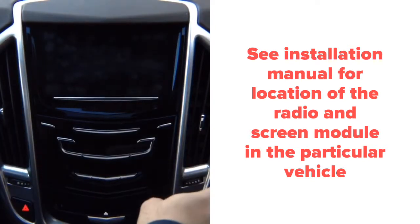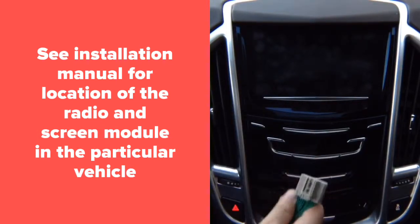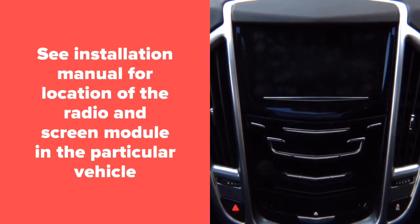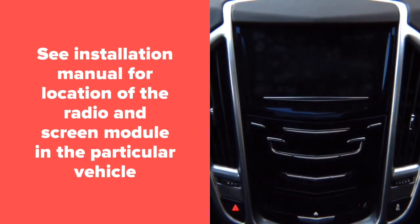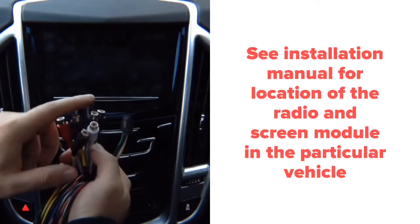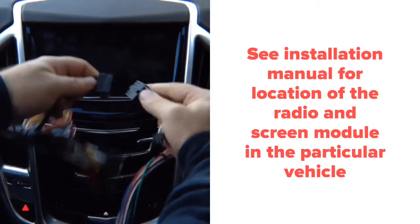Typically, installation is done behind the glove box. Behind the glove box you find a connector — you unplug it, plug the factory connector into the module and plug this back in. It's 100% plug-and-play. Then you have a second connector, which is black in color — unplug it, plug the supplied one back into the module, plug the factory connector back in. Take the main harness supplied, remove the tie wrap — this has your camera input, audio, and microphone for Apple CarPlay or Android Auto. The harnesses join together and plug into the module.